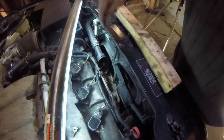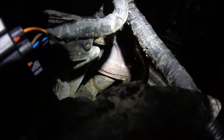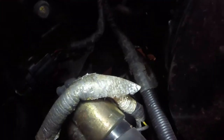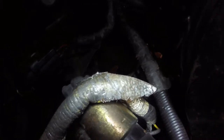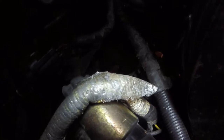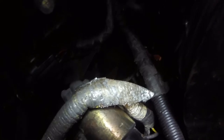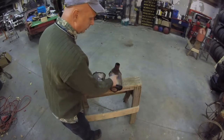The front air intake scoop joiners are kind of a pain to pull out, but just work at it — bending and flexing. If it's warm it's a big plus. Now the problem is going to be the rear cat. Here's the aftermarket cat installed, there are the new bolts for the catalytic converter, and there's the new oxygen sensor I put in. On all these bolts you can use a very long extension and a universal breaker bar — I think it was a 13mm deep well socket.